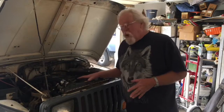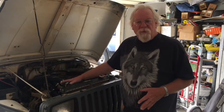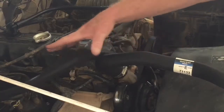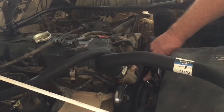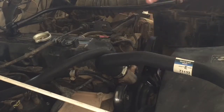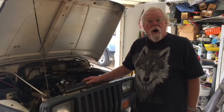We finished it up. Here's a brief summary: the entire cooling system has been totally redone. We've got new hoses all around including the bottom hose, a new thermostat, a new water pump, everything cleaned up and Permatexed properly, and fresh antifreeze added. This thing shouldn't give us any problems whatsoever — on to the next project.